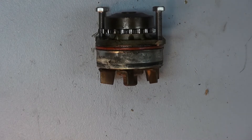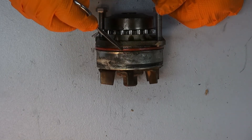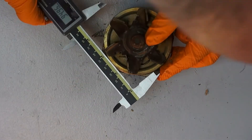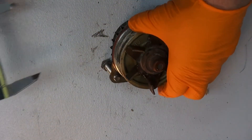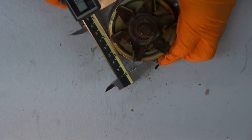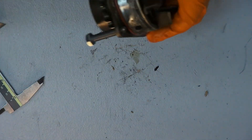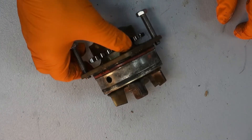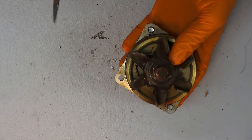One other thing to notice is that these diameters are different. The outside diameter of the coolant seal is smaller than the oil seal diameter. Measuring with calipers — it's tapered — the coolant seal is about 71.5 mm and the larger oil seal diameter is about 78.5 mm, though it's hard to get a precise measurement since the calipers don't span it perfectly. That's a look at the water pump for the Nissan. It's a little hard to get to since it's driven by the timing chain, but the reason this one failed is the seal on the back.